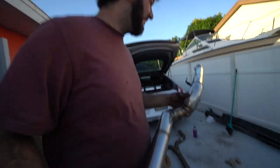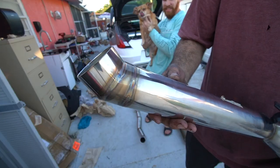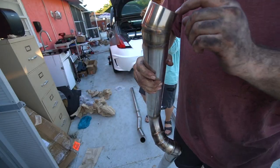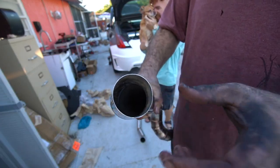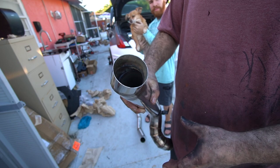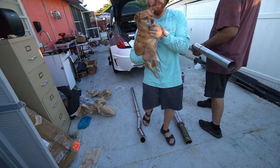Here are the welds, and the man behind the welds. These are the outsides of the welds, obviously very pretty. But the important thing too is the inside — we actually back-purge all of our piping, which is where we put argon in the middle of the pipe so it gets rid of all the oxygen and it makes a stronger, better bond.